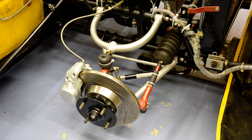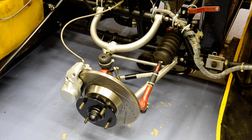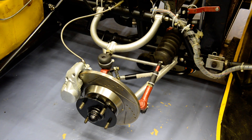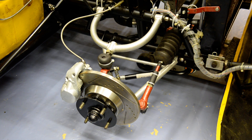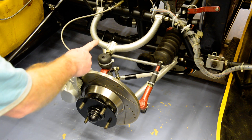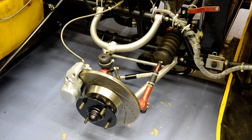Those familiar with 1960s racing cars will spot the classic suspension setup of unequal length wishbones. The top wishbone is peculiar to TVR and is fitted with polyurethane bushes. There's a top ball joint here, which is adjustable. Changing the distance between the top pivot and the top wishbone will influence the camber angle.